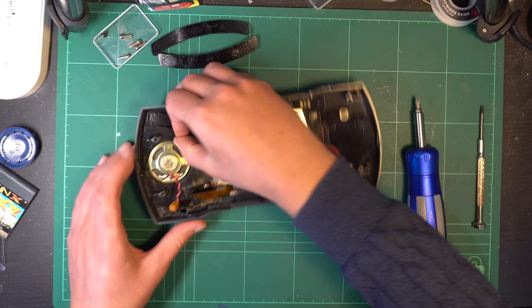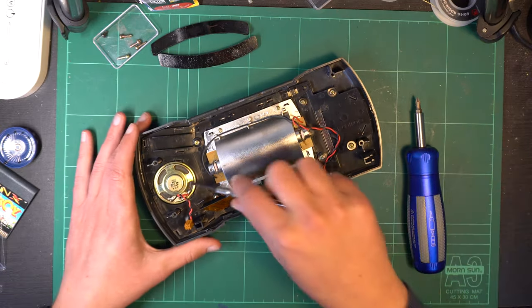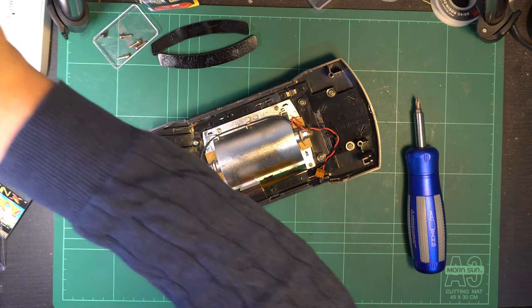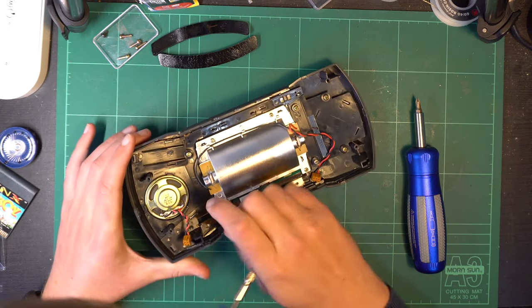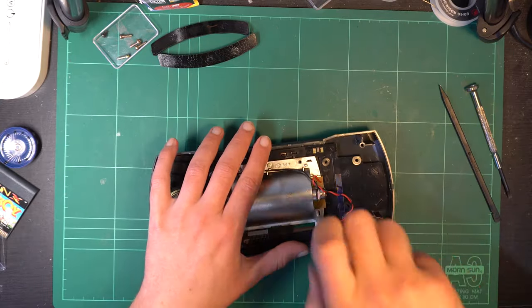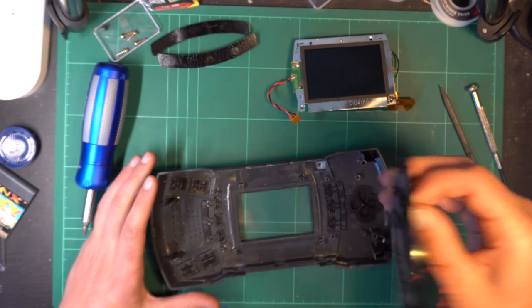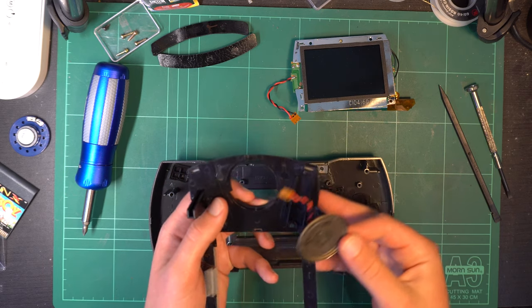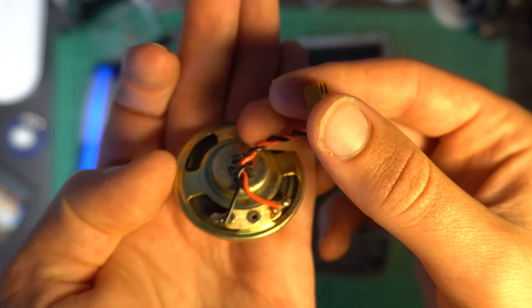If you're buying locally like I did, I think this cost me something like $4. The speaker itself is held in using clips, and I struggled to actually remove these while everything was assembled. So we'll be removing the speaker and button assembly and simply flexing it out. To remove it, there are six screws — four on the right, two on the left — although there are another four smaller screws holding in the screen assembly. And with that, the speaker is free. There are only two wires for the connector — one for positive, one for negative. It doesn't get much easier than that.